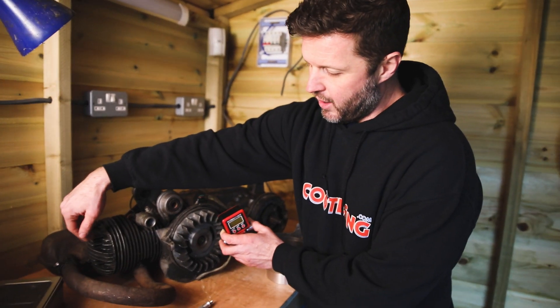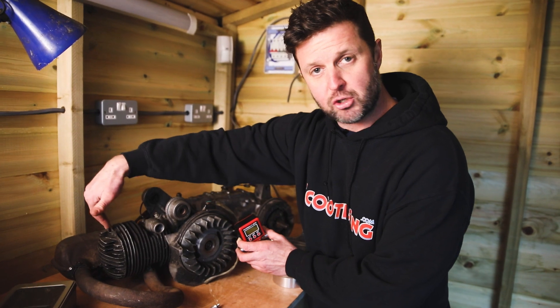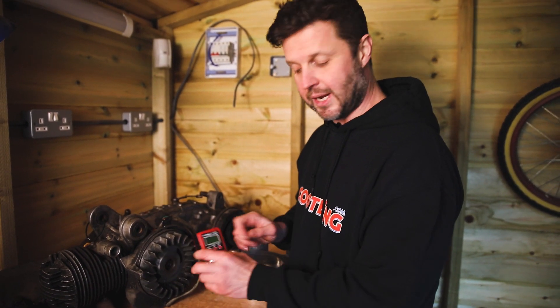The same can be done, once the cylinder head is off, with a feeler gauge inside a port — whether it's a transfer port or the exhaust port — and again, you rotate this to find the number of degrees that that port opens and closes for. This reading will tell you that.